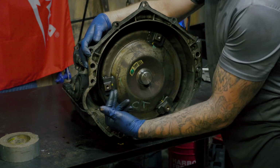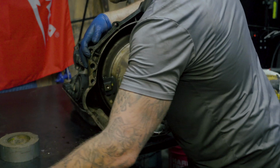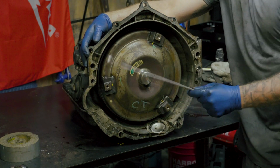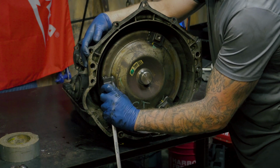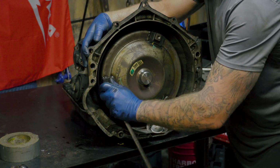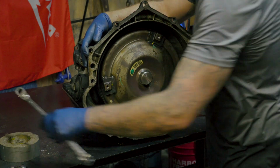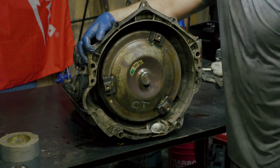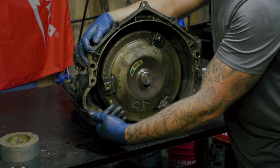But you'll come up through here, and this is where the mountain wrenches that I showed you before come in handy, because you're up underneath. You'll come up and you can get to it. You can get some good torque on it to remove or to install. You're also going to have to hold either your harmonic balancer, or use a tool that'll hold your flex plate in place.